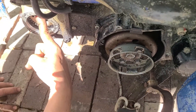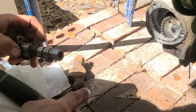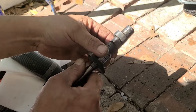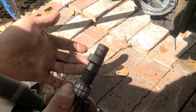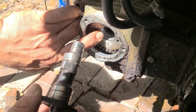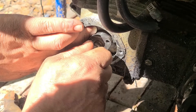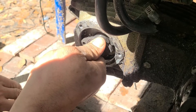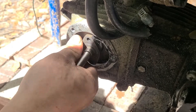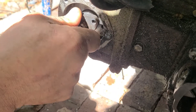Now we're going to work this camshaft real quick. Set this down a second. Not at top dead center. Some people like a little oil on the cam when it goes in — I'm not opposed to it, but I'm not really concerned about it at this moment. It's not a Corvette engine. So we're going to work this thing in, a little at a time, until I can get it to agree with me. It's probably one of them valves in there that's got it. If you can work past it.